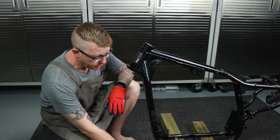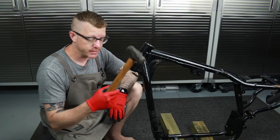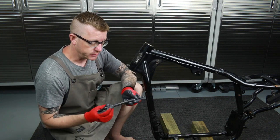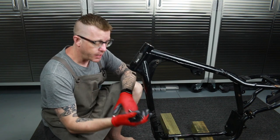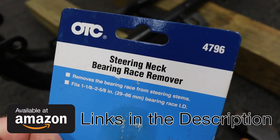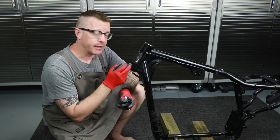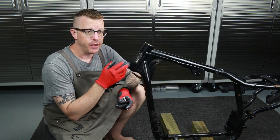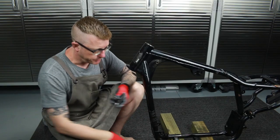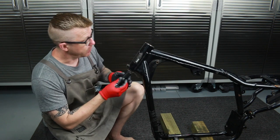To get started we're going to need a few things. I've got a two-pound sledge — this is handy, not necessary, but I like having a little extra weight on my hammer. A drift — this is useful if you don't have this bearing race remover tool that I'm using in this tutorial today. There are links down in the description so you can buy one. They're super handy — they don't just take the races out of steering necks, they take the races out of just about any kind of bearing out there. They're about $40, not too bad. And a socket wrench with a half-inch socket.